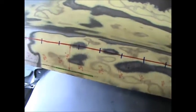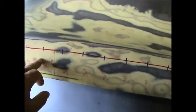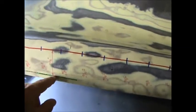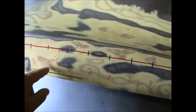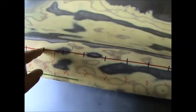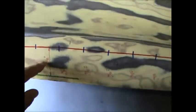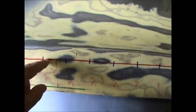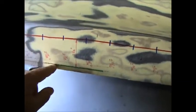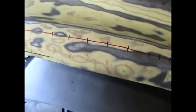I haven't cut it. I'm not going to cut the Camaro anymore. I'm going to trim the panel to fit the car. So it's 2.5 inches from the top of the flange to here, and then this represents from the cut to the line. As I make my final dimensions, I'll subtract a 1/16 for the thickness of this. Then we'll start test fitting it, and grind the panel until it fits right and proper.